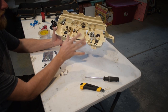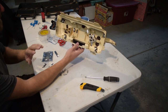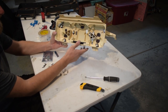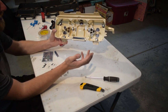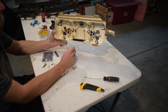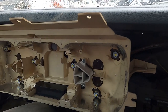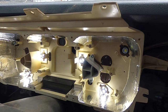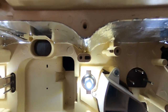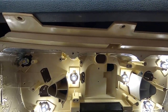They're all in. Now I'm going to take this back out to the truck, plug it in, and turn them on to make sure they're all functioning correctly before we move on. With these LED bulbs, sometimes a few may not be working, or it may seem like they're not working but you just need to pull them out and turn them 180 degrees to change the contacts. Sure enough, the two corner ones needed that — just flipping them 180 degrees was all it took.